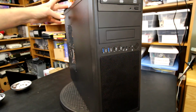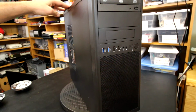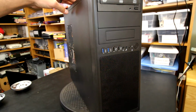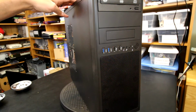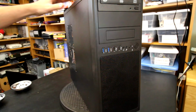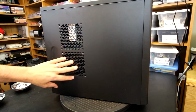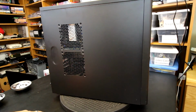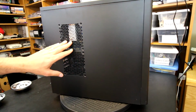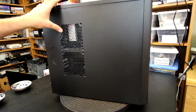motherboard. On one side we were hitting the processor VRM cooling heatsink. The other side we definitely hit that anyway, and possibly the RAM as well. So for cooling fans on the top, you're probably going to find that you can't use it, so just something to think about. However, that fan could be pulled off the top and put into here. There is plenty of room for this lower portion to have an intake fan. With a tower style heatsink, you wouldn't be able to put one up here, but it is something to think about for use of that fan.